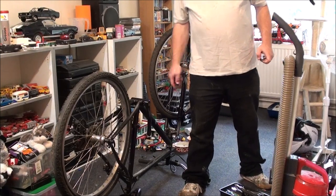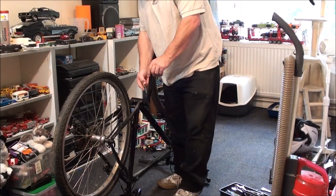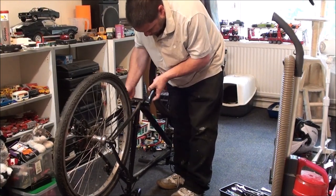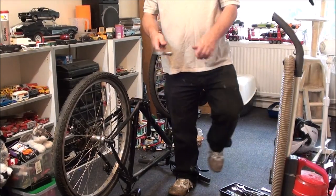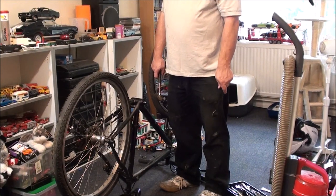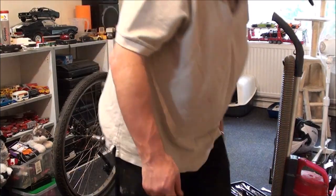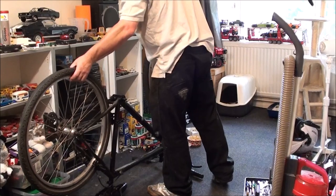But what I do if I have to use a hammer — what I would do is lay it on the floor, that bit out like that, and just give it one good hard whack as close as I can get to there. And that should, hopefully, just fly off and not damage the crank too much. I've got a little play in there. Shows what I know — I just tapped it off. Usually there can be a pain in the backside, but apparently not today. It came off a lot easier than I was bargaining on. And it caught me off guard — not that that's a bad thing.